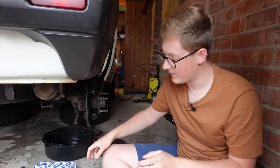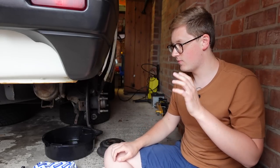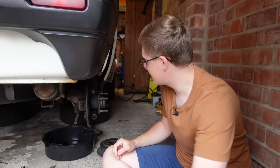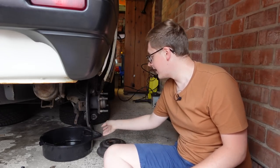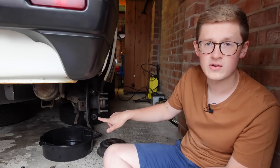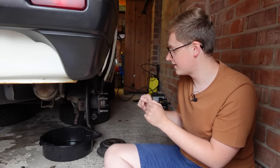I don't know which side is which anymore — they've got mixed up. It'll be a bit of a guessing game. I have a multitude of tools, the drum off the rear brakes, brake cleaner, new parts, lots of tools, and a drain pan to catch all the brake cleaner, because we're going to completely clean the backing plate. It would make sense to take the backing plate off and do this properly, but I didn't want to take the wheel cylinder out because I don't want to end up bleeding the brakes. So I decided to leave everything intact and clean it as best I can, then reassemble.